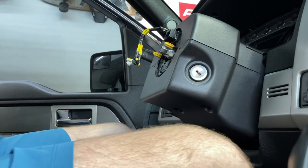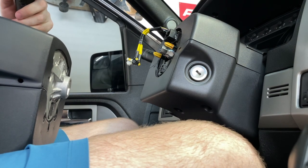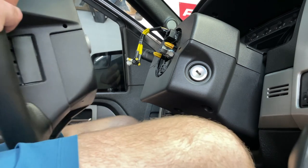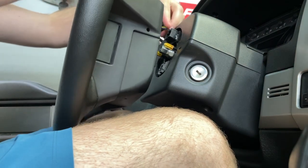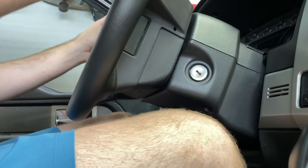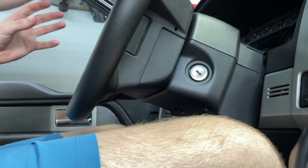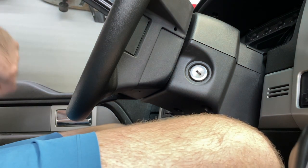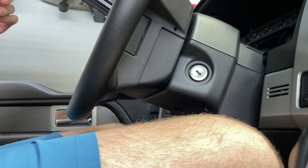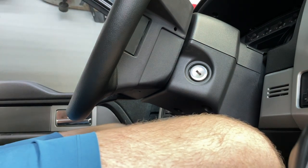New wheel — it's right here in my lap now. There's the connector. All we need to do to get the new wheel on is feed these guys through for the airbag and shove that wheel in place. And right there we have that installed. That's the new wheel installed. Basically what I'm going to do now is go through the process of putting the bolt back in, plugging the connectors back in, so on and so forth.